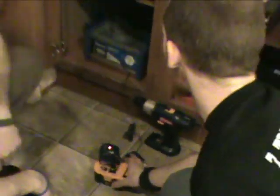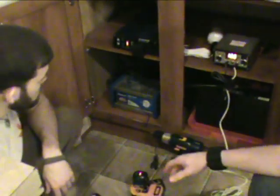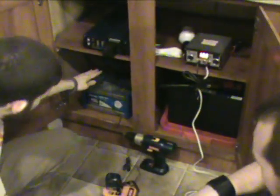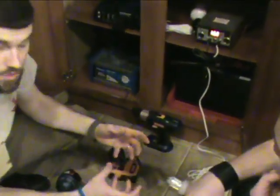Over here you've got your inverter. You can see we've got the chargers hooked in — you turn that on and it lights up. So if you've got power tools and things, especially when your power's out in your house, you can hook this on and see it's going to charge batteries for you. It's not just for when things go bad — if your power's out, these can always just be a benefit throughout any time of year. And just in case we have some days where the panels don't give us power, we've got a battery charger here that we can plug in during good times to get a good charge in case it's been a bunch of cloudy days. But being they're amorphous panels, they're going to get sunlight charging the panels even on a cloudy day.